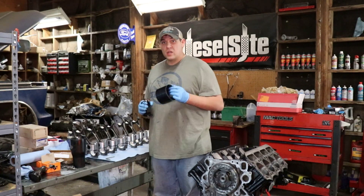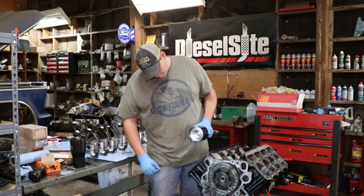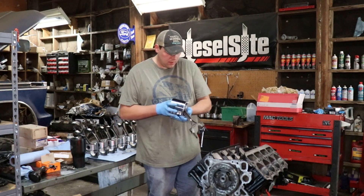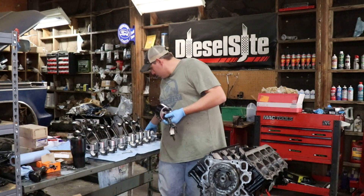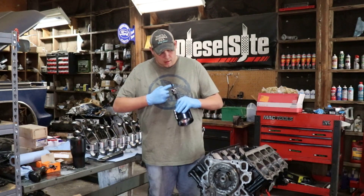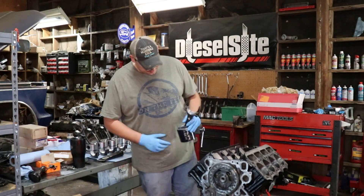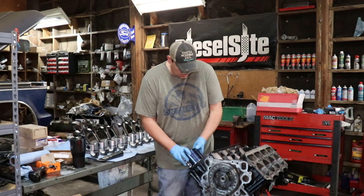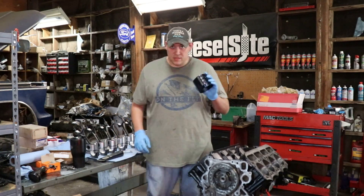Next I like to put a little coating of oil inside the ring compressor. This is cylinder number one — we've got it at top dead center, and cam direction is going that way towards the V. So I'll take this and throw a little of that on — a nice little coating, just like that.